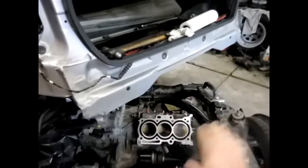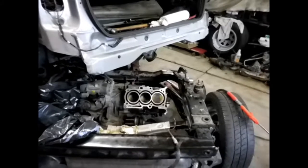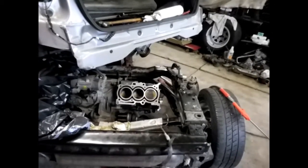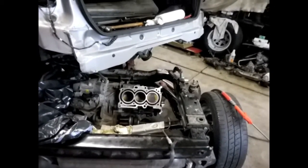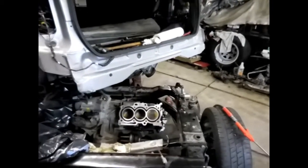Back on the little Smart car today. Got a new head gasket, new head bolts. I'm going to start blowing these holes out, clean that surface up, same on the head. We're going to go ahead and bolt the head back on it, and I've got to get some more specs on the camshafts and then we might put that back on today. A few more things, so let me get started.